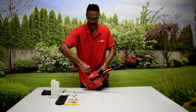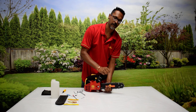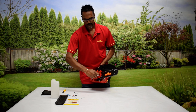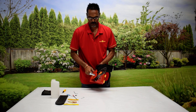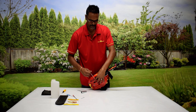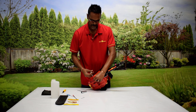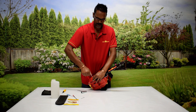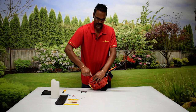When tightening, don't over-tighten — it's very easy to do. You just want to make sure you can pull the chain up, but not to a point where it's sagging. Once you've got it in the right position, tighten the nut up to hold the guide bar and the clutch brake in place. Don't forget to put the allen key screw back in. Once that's done, you are now ready to add your petrol mix and start the machine — brake on, brake off.